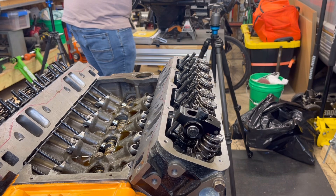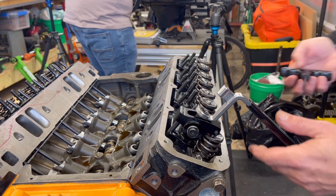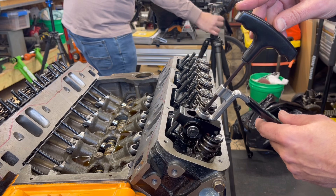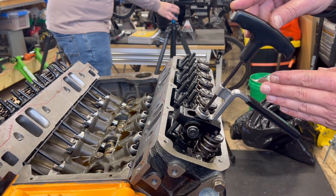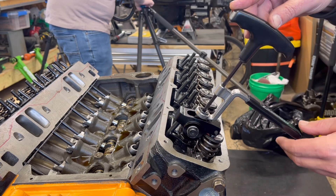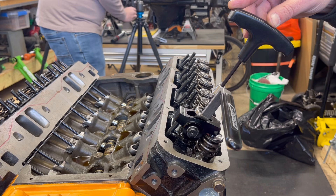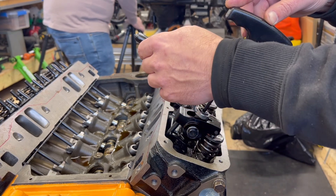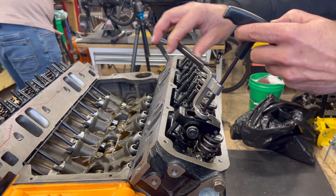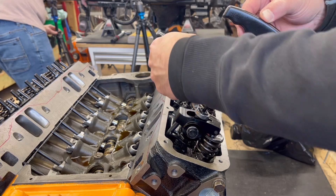This is the cool part. I'm going to put this here on the nut and take the T-handle right into the center of the poly lock. If you look right here, I'm looking at six o'clock. Here's nine o'clock, here's twelve o'clock. If I went to nine o'clock, that's only a quarter turn. I want to go at least a half turn on this, so I'm going to go straight up and down — there is your half a turn. If I went to three o'clock, that would be three quarters of a turn, but we're going with a half turn.